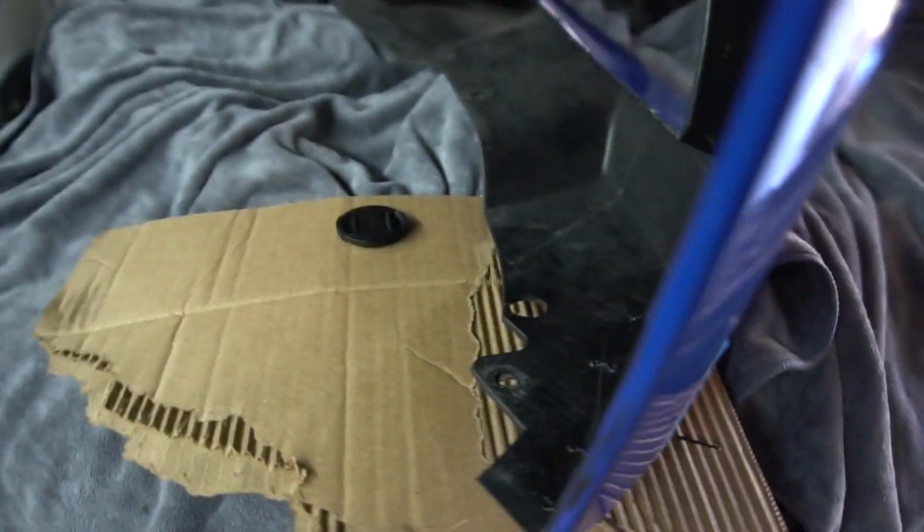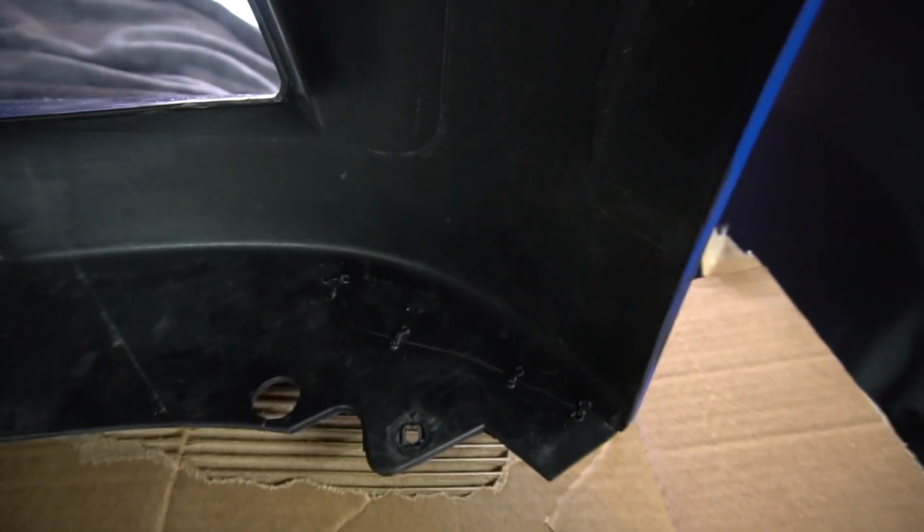I also put a small divot where the crack ends there. Hopefully that reduces the risk of the crack spreading. I really didn't want to drill through, as I said before, because it'd be much more visible if it came through on this side. So that is the only reason I've done that. But I believe the next step is now to plastic weld the thing together over here.